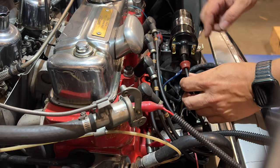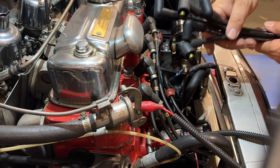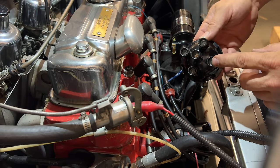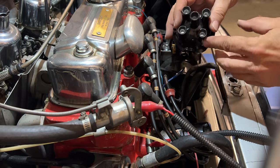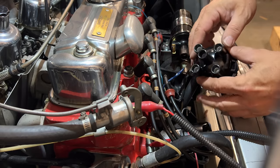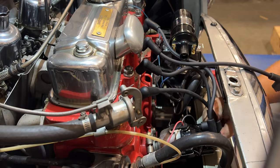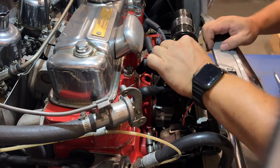Now that I have the new coil here, you can see what the problem is — you can't put a screw-in type HT lead onto a push-on coil. I'm going to be converting to all push-on leads. These are push-on on both sides, which means I also need to change the distributor cap to a different type. The HT leads come out of the top of this cap instead of out of the side. I'm going to take this cap off leaving all the wires in place — these are labeled 1, 2, and 3 — so that I can get them back in the same order when I put the new wires on. Then you can put the cap on and get them connected to the correct place.